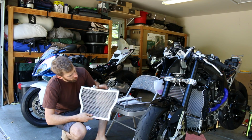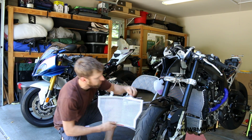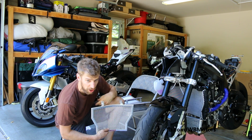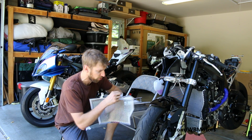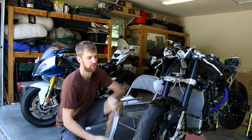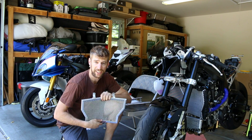So what we're going to do is you pretty much put her in here and you slide it up. These two bolts, we loosen them out. We pull the lock pins, and we remove the bolt a few threads to create the extra gap, and then it's just going to hook underneath the bottom. It just hooks on, and then you put on the lock pin, and it's really that easy.